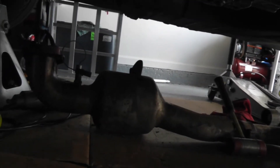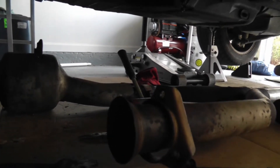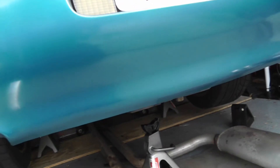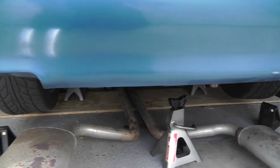The exhaust is down - that catalytic converter is down. Once I took off those two brackets that are on the transmission bell housing bolts, which hold most of that weight, and those were rough to get to but once you get them the whole thing comes on down. Then I slid it forward and it slid out of those little pockets in the back brackets, and the exhaust system dropped down. When I put on the new mufflers I'm going to try to cut these off flush so I can reuse that center section.